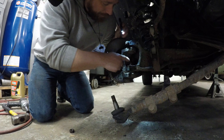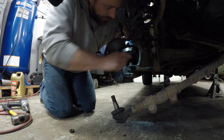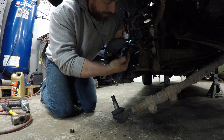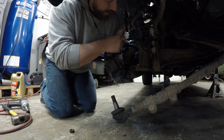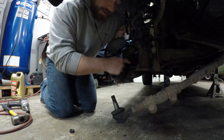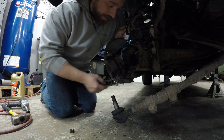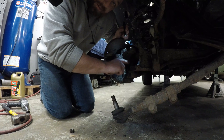What I'll have to do next is pull the cotter pin out of this lower one here and do the same thing — loosen that nut up. The upper ball joint goes through this hole and the same thing here; there's not a nut on this one, just a clamp that holds the ball joint. So this one you take off, but put that nut back on just a couple of threads and then beat on it and it'll fall out. If you don't put that nut on it and you beat on it, the whole spindle will drop and you may end up messing up one of the ball joints or the rotor. So always remember to put that nut on there.